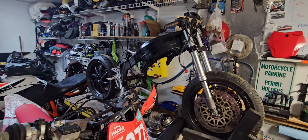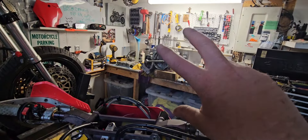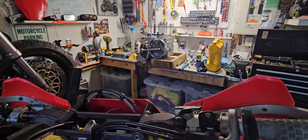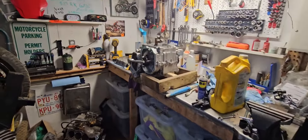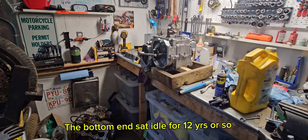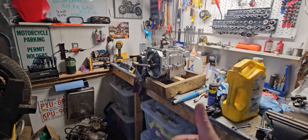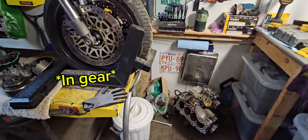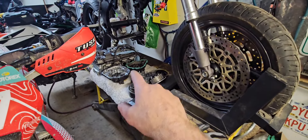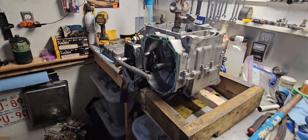I was going to put that on top — you have to turn it upside down on top of the bottom of the block for the CBR project. Unfortunately the crank was seized and I got a little flustered by it yesterday. I checked that the bike was in neutral — not that it really matters, that's a 954 bottom end and that turns with gear on. So I took the magneto off and took the entire clutch basket out just to have the crank free.